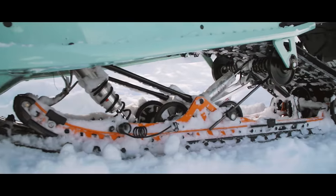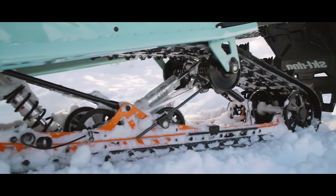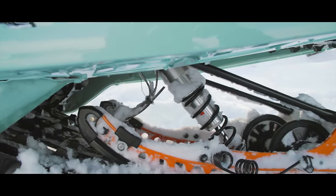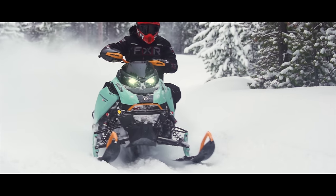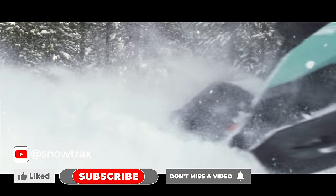On the C-Motion X, the rear arm and rear shock have both been lengthened around 13mm, and the front arm has been brought back into the chassis about 30mm as well. With this combination, you get greater suspension travel and a way better performing rear suspension that's better on-trail but also more effective in deep snow. It's a total game-changer for the Backcountry G5.